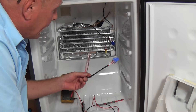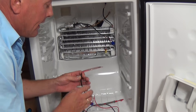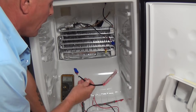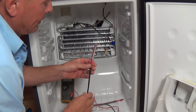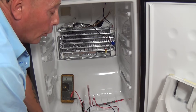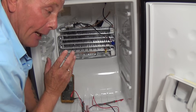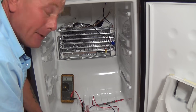The last thing we're going to check is the thermal fuse — I actually know that this thermal fuse is blown. Thermal fuses can go for many reasons: it may have got stuck on defrost for too long a period, it may have exceeded temperature boundaries and got too hot. The main reason on this type is sometimes moisture can get into the bag where the thermal fuse is, or the defrost PCB has stayed on too long. On our graphing system we estimate the defrost on this should be about 10 to 15 minutes maximum.